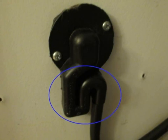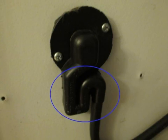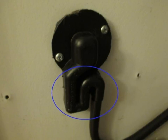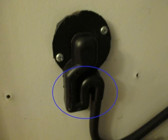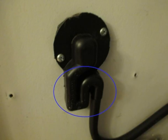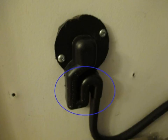Once I removed this device and unplugged the hose, I was able to blow some air through it, and that's when I noticed there were some particles that came out. I don't know if it was food, dirt, or dust, but that was preventing the water from properly draining. Now that I've replaced it, I notice there are no more leaks into the freezer. I hope this helps you.